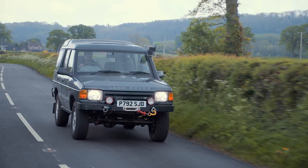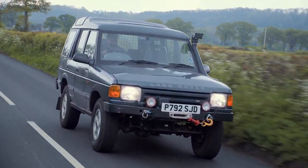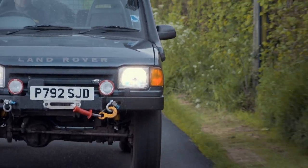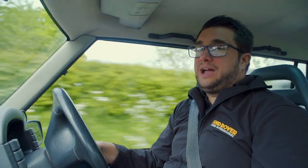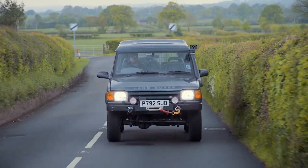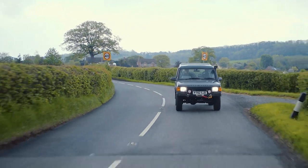The interiors on these early Discoveries are quite rudimentary — they'll rattle and creak over bumps, but that's part and parcel of the vehicle. Make sure the heater works properly; you should get nice and hot in a Discovery, unlike a Defender. Check the seats for damage and wear on the bolsters, and check the steering wheel for wear and any stickiness. Check the sunroofs work if they haven't been sealed up. On three-door models, make sure the seat bases fold properly to allow access to the rear seats as these fail quite regularly and are difficult to find replacements for. As you're driving, check the mirror for smoke under acceleration — a little black smoke is normal but white or blue smoke could indicate an engine problem.